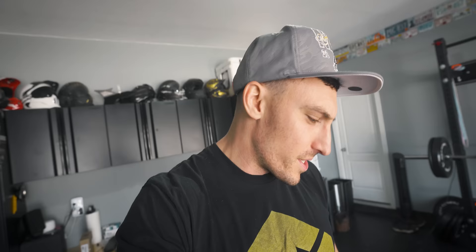Good morning everybody — we're back day two because I ran out of time yesterday, but we are in the home stretch. I checked the product page for the stage 2 kit and realized that you don't actually have to remove the flappers, because with the flash that Bren Tuning does for stage 2 they can actually just control the flappers and make sure they're open all the time. For two reasons I'm going to go that route: one, it's easier — I don't have to take off the air box and unhook a lot of the stuff down here — and two, it's easily reversible. If you wanted to have that flapper functionality back, you still got them in there, and you can just put a new flash on that doesn't control the flappers.